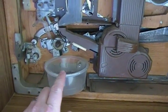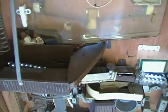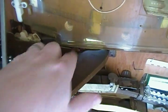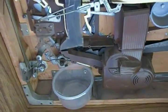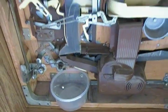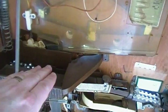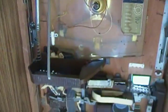There is a cup down here, and on occasion a ball will come out of here for two reasons. If this tray gets too full, then the balls will spill over into that hole right there, and then they fall down into there. So if the house is winning too much — if the machine's too tight — this tray will fill up and they will overflow into there. So that's kind of how the machine works.